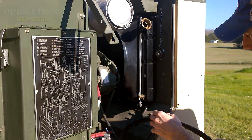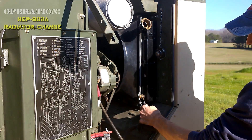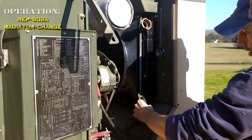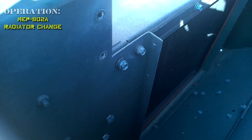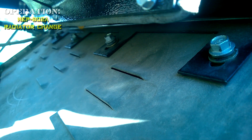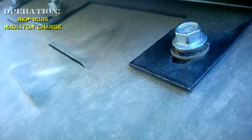This isn't like taking an old Chevy radiator out — there are a lot of bolts and you've got to remove the top enclosure, but it's not too bad. To get all these lined up at the top, you need to keep these four underneath the radiator loose so you can slide them up and down and adjust them.